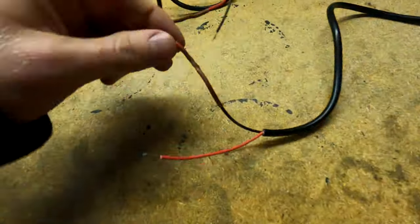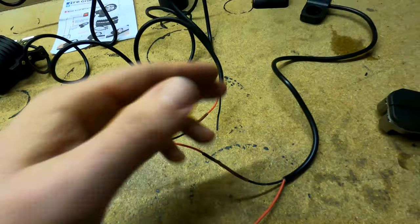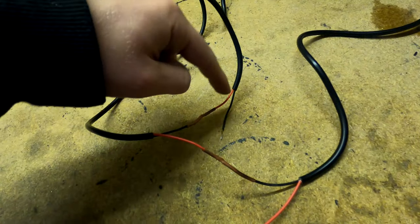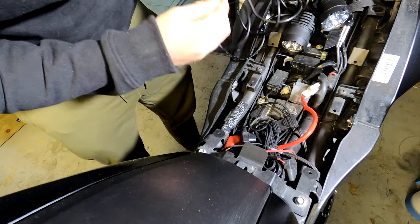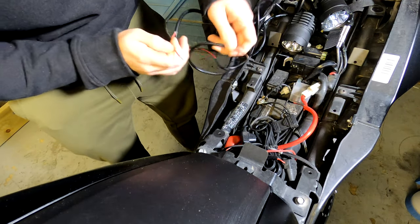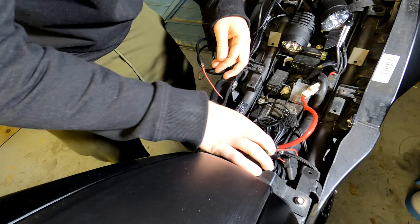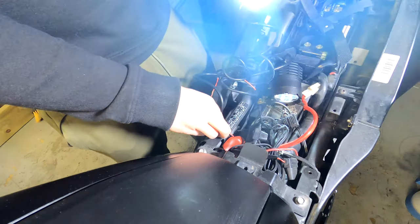I've soldered the two wires together. You essentially strip the wire, twist it together, and melt the solder on the iron — you'll see it flow when it reaches the right temperature. The red goes to the battery, the black and red of the first light are connected, the black and red of the second light are connected, and the black from the second light goes back to the battery as well. Now the only thing to do is test it — I have no idea whether this is going to work. I'm testing on my bike because the NC750 is incredibly painful to get to anything.